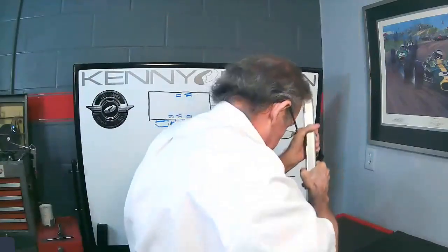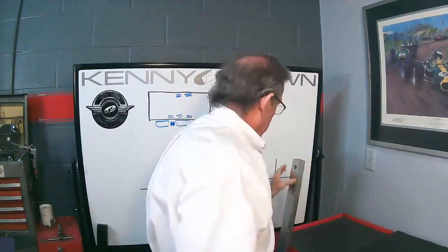So when you jack the car up, you're not going to squash the pinch weld. That's the whole idea of jacking rails, to preserve the pinch weld. Now, on the Fox, S197 and Gen 1 Mustangs, they all weld to the pinch weld. And also SN95 is a little different, but that also welds to the pinch weld.